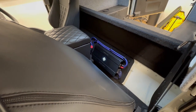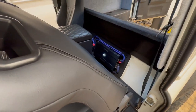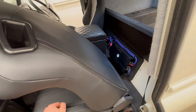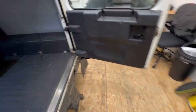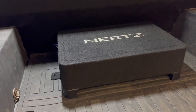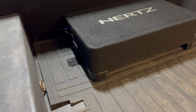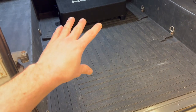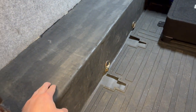For the price and for the time, this kind of surpassed my expectations as well, actually. When I got it all wired in and playing for the first time, a smile of relief came across my face, because it's nice when you put it all together and it works like that straight out of the box. In the back we've got a prefabricated Hertz 10-inch shallow subwoofer in their enclosure — a nice little unit, fixed down with riv-nuts to the floor. Then sound deadened all the floor with 3mil roll-on bitumen sound deadening and then 6mil closed cell foam. We haven't done the sides yet — it's probably going to have to come back. This has a rubberised finish on here, and it already had boards in the back done by a previous owner.